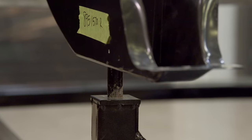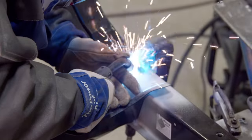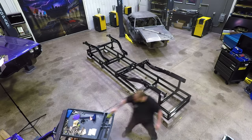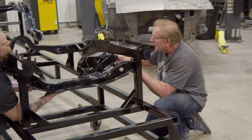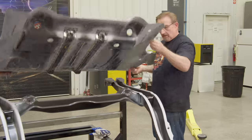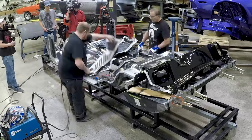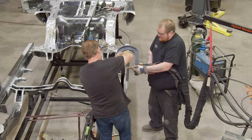When you're building a car from scratch, it's a lot like building a house — you've got to build that foundation, and the foundation needs to be square. We started with the rear frame rails, set those down on the frame jig. Those are established values. We welded in the crossmember, the shock crossmember. From there, we moved to the front of the car, installed the frame rails and the torsion bar crossmember, added the K-member for strength and geometric squareness. We put in the trunk floor, under seat pan, step wells, main floor, and the two hinge pillars.